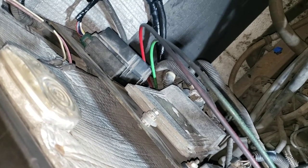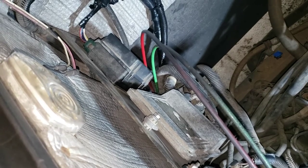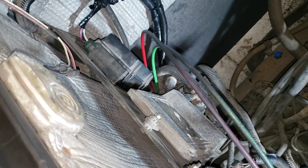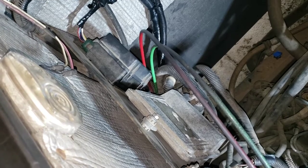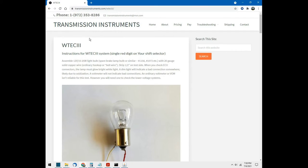After doing some reading, I found in the troubleshooting section of the Workshop Manual, there's a line item for the vehicle not cranking. And it says to check the voltage to the ECU. It may be too low. Well. All right. So at this moment, I'd like to take a little bit of time and provide you with some information that I think might be useful to you.